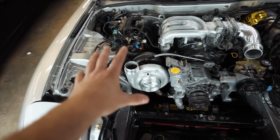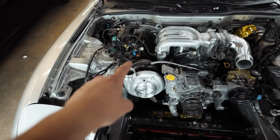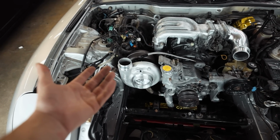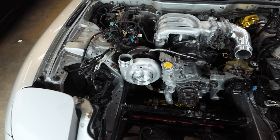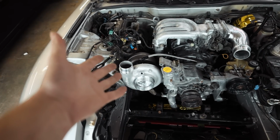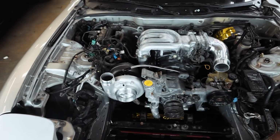In the next video, we're going to pull off the turbo kit, Cerakote the hot side, the exhaust manifold, I guess you'd call it in this car. It's not really a header, it's more of an exhaust manifold. The downpipe and anything else that needs to be, and probably the dump tubes for the wastegates. Heat control is massive on this car.